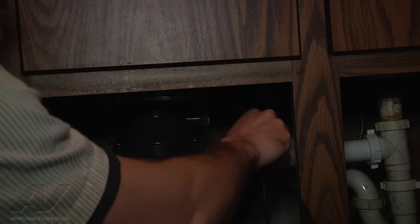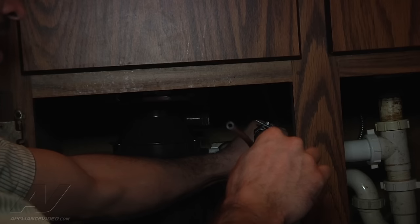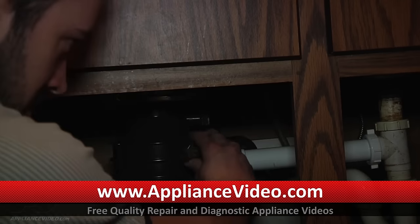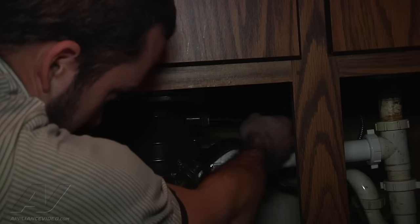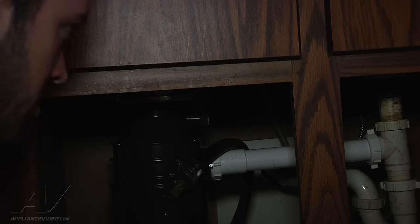This is usually effective if you've got a lot of fat that clogs up the disposal line. A lot of times people will make tacos or whatever and dump the fat down the disposal, and if the drain line doesn't have a good elevation it just sinks down and clogs up the drain line like a clogged artery — and the dishwasher can't get rid of the water. Snaking it out usually clears it. Also, there is a knockout on the disposal that sometimes — if you just recently installed the disposal — you have to knock a little punch out on the inside, and if you forget to do that the dishwasher will not drain either. We'll go ahead and hook this back up; we know the whole drain line is clear. Tighten the clamps down and run one more test cycle.